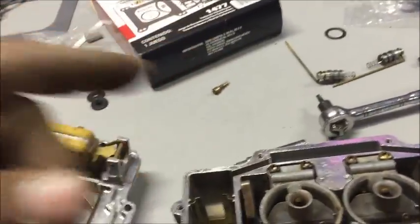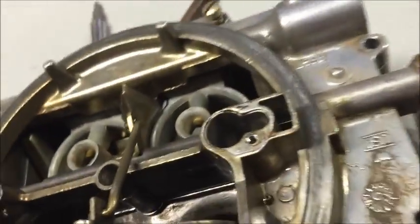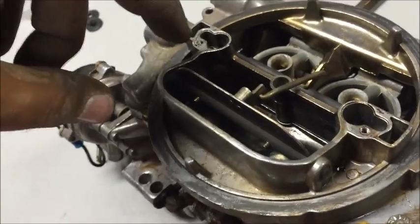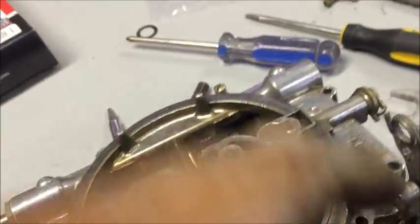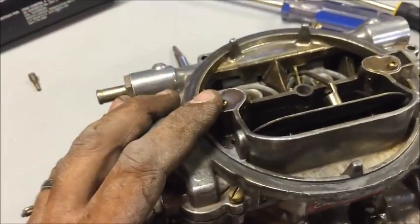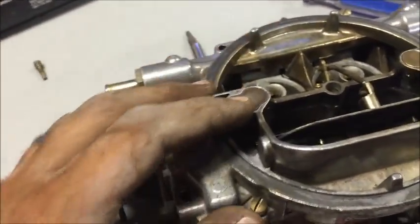There'll be seven screws on top, and of course our other two jets. When you set the top back down on there, don't tighten the screws all the way — just put a couple, one on each side. Because you want to make sure that those little air jets right there and right there are seated in there the way they're supposed to be. You don't want to try to pry this on — you'll end up breaking them. If you get those backwards, that jet will be flipped around and pointed towards the back. As long as those two jets are lined up, if they're flipped around it won't push down on there. Also look down inside the holes and make sure the gasket is not shifted. Make sure you put that gasket on prior to putting the float bowls on — that's the only way it's going to go on.